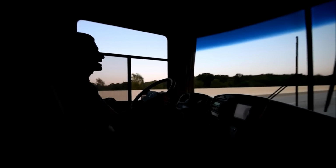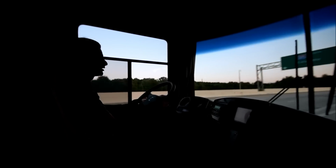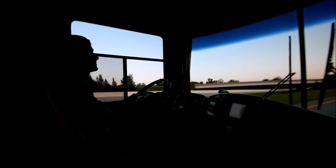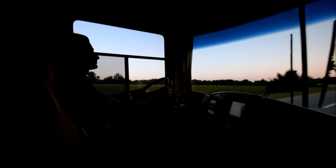It also has a 2-stage exhaust brake system, which is nice. The high stage is very strong. In fact, using it around town, you can really get away with only braking using your actual air brakes once you get to about 15 miles an hour, which is nice. Not only does it save you money, it's a lot smoother coming to a red light. It also has a low stage, so if you want to just coast down a hill and not gain speed, you can just put it on the low stage exhaust brake.